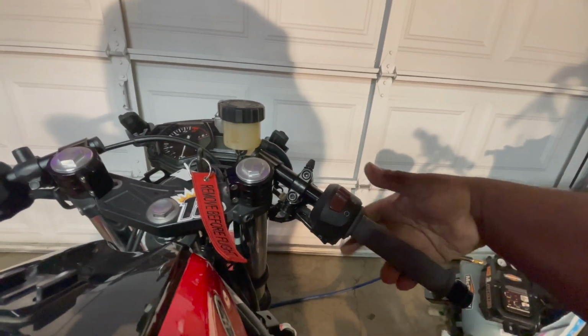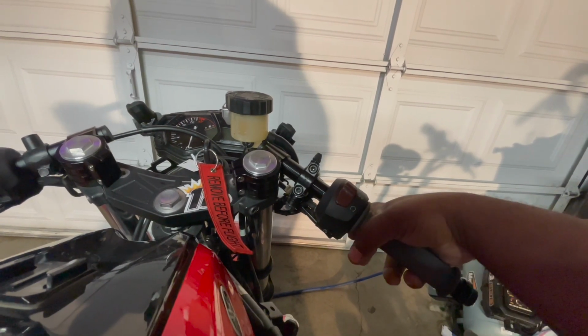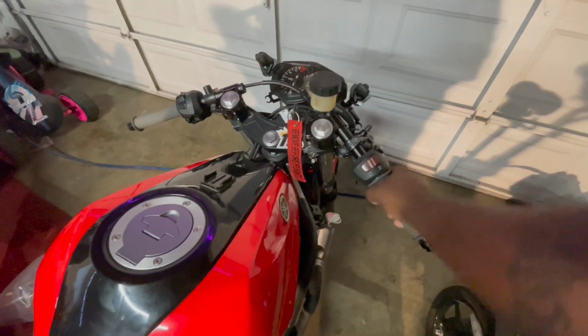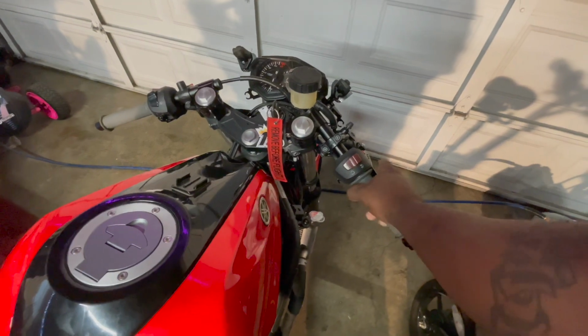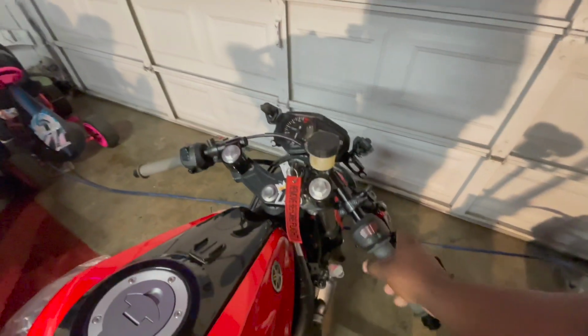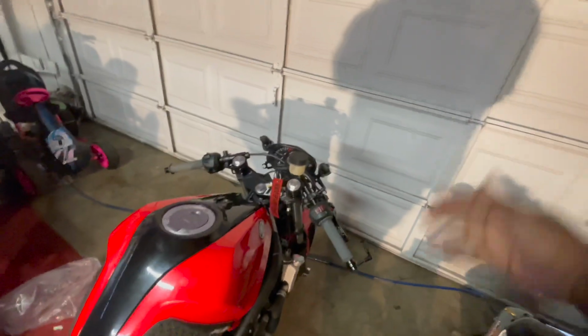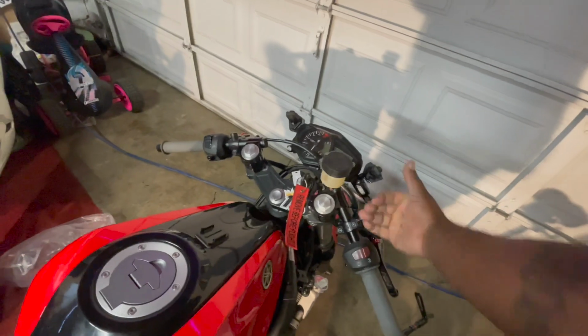See, my fingers are down now, not up. I go to grab the brakes and they're up here. See, now they're down here. When you pull them, you're not rolling the throttle. You're just pulling it to yourself. When they're up high and you pull it, you could possibly roll like 5% throttle on. So that could make a weird condition where you'd slam yourself. But now we're nice and clean and we're out so far.